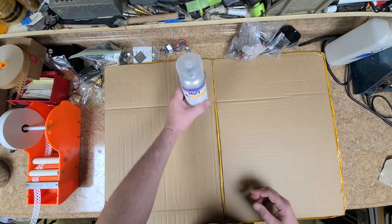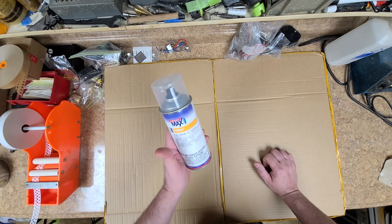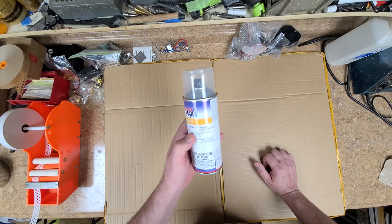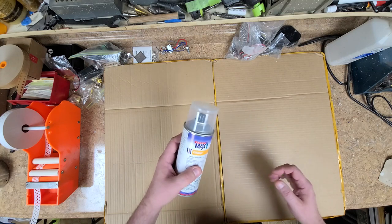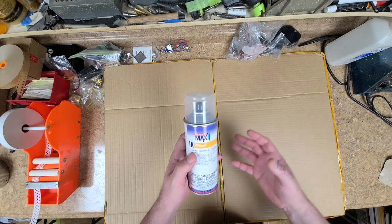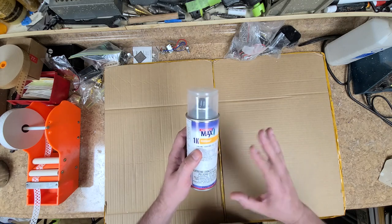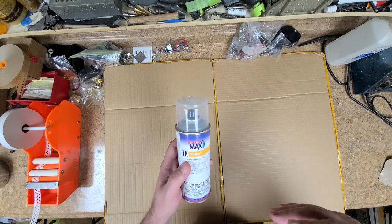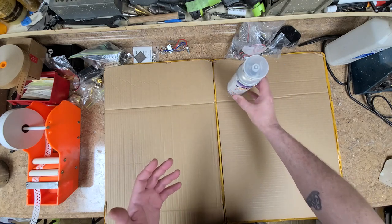This here is a polyurethane — this is Spray Max, and this is part of the pearl white system. This is the liquid pearl, and you spray it on top of the pearl white to give a little bit more enhancement of the pearl. It has a slightly different type of pearl mixed into a matte finish. This is not a clear coat or finish coat, so you still have to put a clear on top of this in order for it to adhere and work properly.